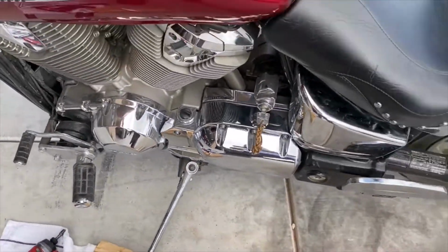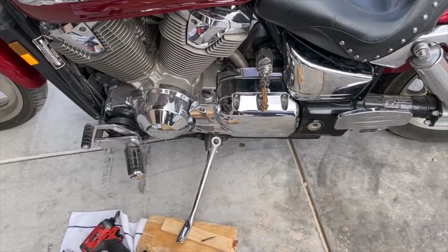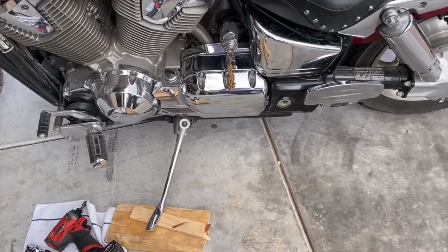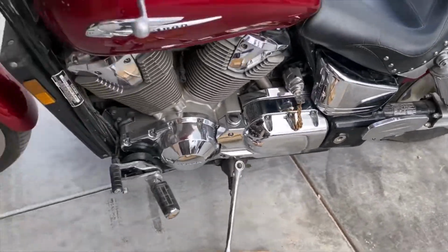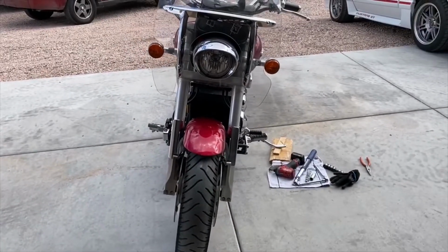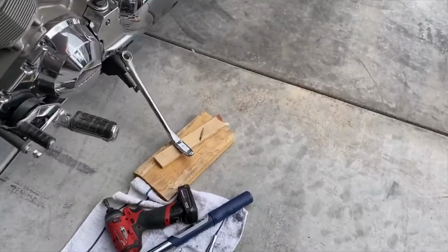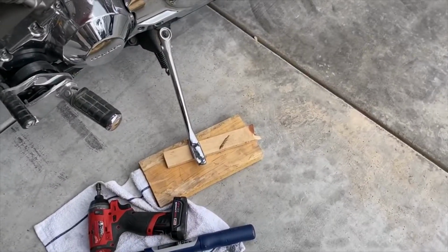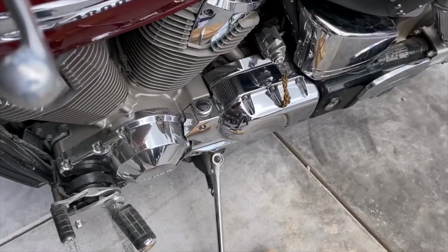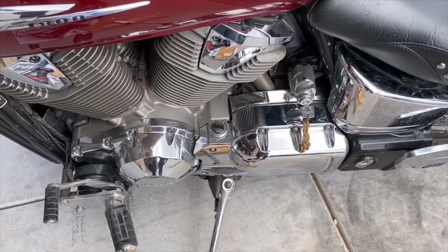Okay, so you let it run now. I'm doing the oil change part. You let it run for about 2 minutes just to heat the oil up. And then what I normally do is, in order to get the bike semi-level, it's still a little leaning, right? But semi-level, you put some wood blocks, some shims under the kickstand. And then when you drain the oil, you can get a correct measurement and drain it out fully